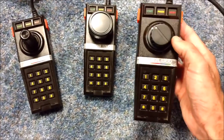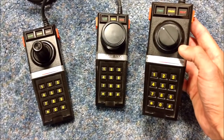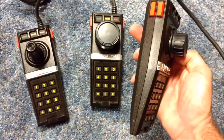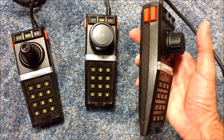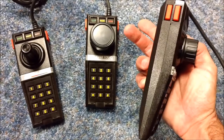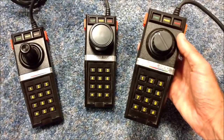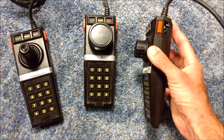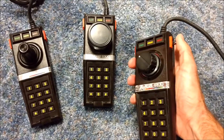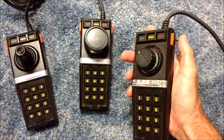But you can see, again, like the 2600 paddle, the knob here I got at Radio Shack fits in really nice. Actually fits in a little bit better, because the potentiometer you buy from them has a long shaft. You have to cut it. So I cut it down to length. And it works really well. But this has the addition of being able to work with Pole Position. You're like, how is that possible? Well, very simple. Look onto the side here, and I've added a switch. So this switch is actually wired to where the lower potentiometer would have been.